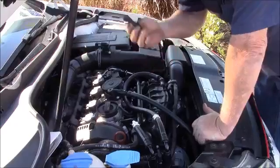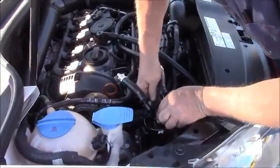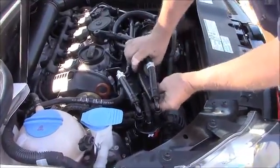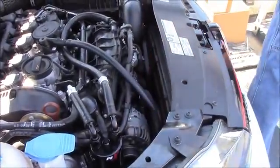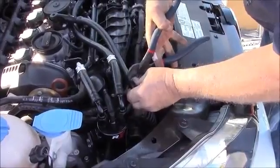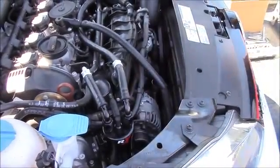So, okay, we're going to put this 3/8 to 1/2 inch adapter, be in your kit. And then we're going to measure. Cut this. And this is our inlet from the crankcase coming into the center of the can.